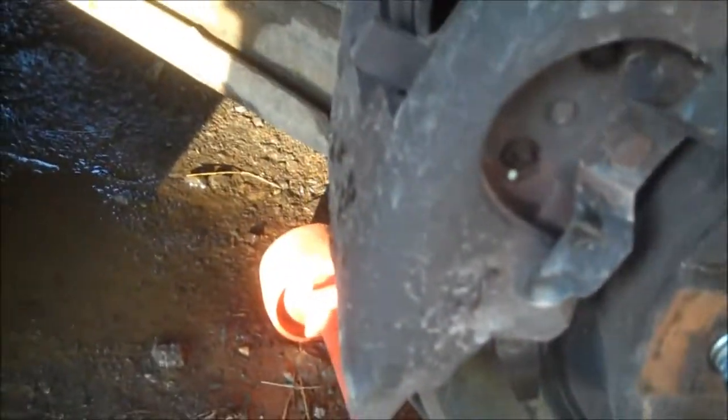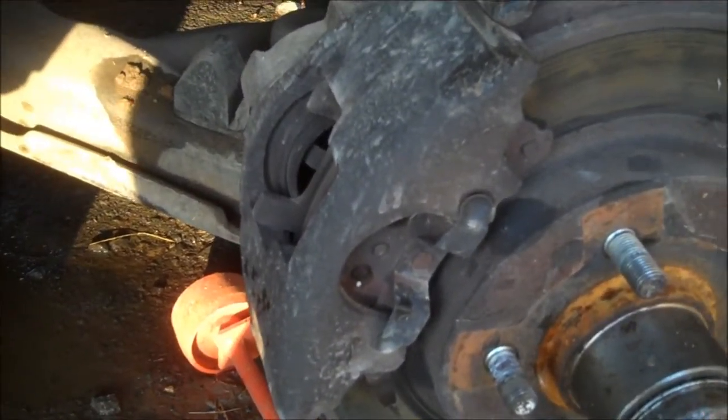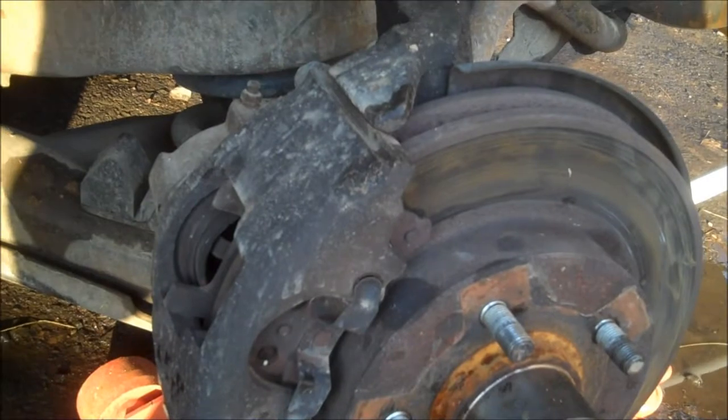Now I've gotten in here and as you can see there's still plenty of brake pad. The parts you want to watch are between this piece of metal and this piece of metal — this is the rotor. There's actually quite a bit on there still, and same thing on the front side, but this isn't the one that was squealing. Since they're close anyway I'm going to go ahead and swap them out. I've got a set of performance pads — the porcelain ones — and I've always had good luck with them.